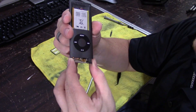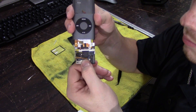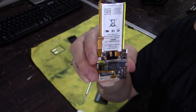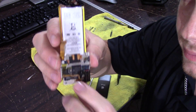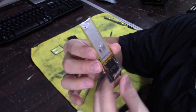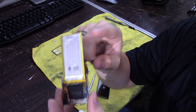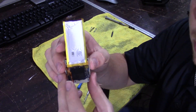And that is all there is to the iPod Nano. As you can see, that's it — it's mainly just the battery. If the battery was bad, it is just glued onto the back. The only thing is, the cable that goes to this is soldered onto the board, so you do need a little bit of soldering skills, but it's not too difficult.